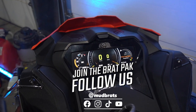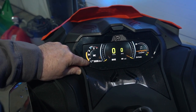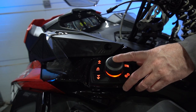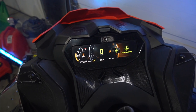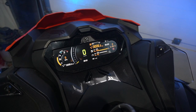You want to make sure that you are actually in odometer mode. This looks like it is, but it is not — you see this says A, it's Trip Meter A. We want that in total kilometer mode. You press down on the center of the joystick, it will bring up your launch stat slash trip menu. Move the joystick to the right and you end up in your odometer trip menu.